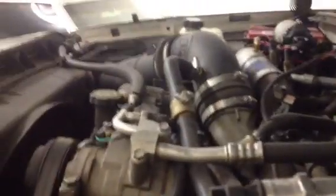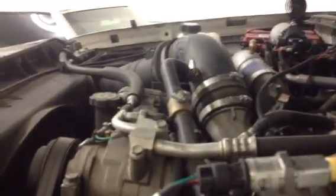With the regulator, there are two screws. The one on the front is preset from the factory — try to leave that one alone. The one on the back, just under the coolant hoses, you can fine-tune, but try to leave it as well. Email me if you're still trying to get it tuned right and want to adjust that. Just use the ball valve to give it more CNG or less to adjust the flow.